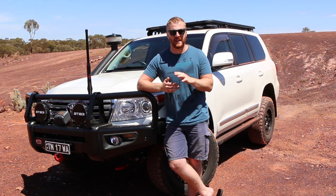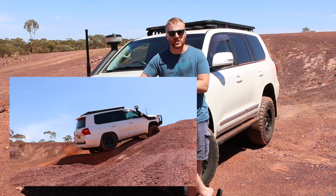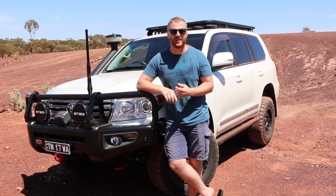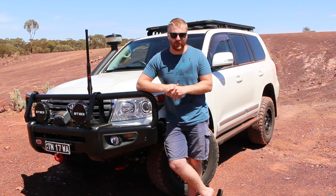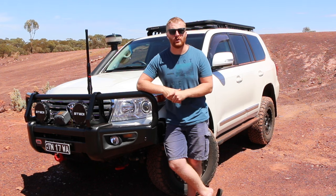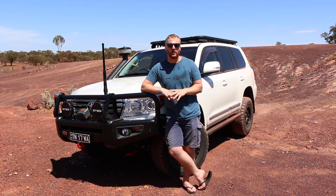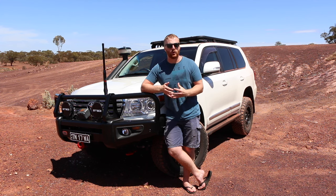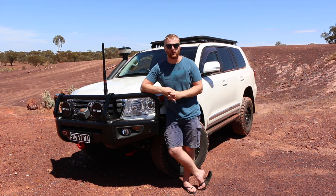You probably saw the wheel start to spin and then the car came down when it lost momentum, and those spinning wheels got traction with the dirt and halted immediately. This puts a lot of stress on drivetrain components, especially things like your CVs, axles and diffs. Crawl control allows you to avoid needing that momentum and speed to go up obstacles, sending power to the wheels that do have traction on the opposite sides of the axles. The only time crawl control really isn't going to work is when all four wheels are spinning at exactly the same rate with very similar traction — such as on a very steep hill or stuck in a bog — and you're going to have to recover some other way.